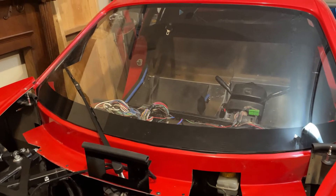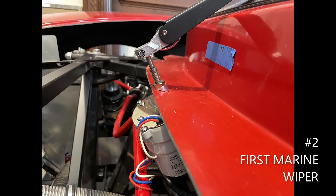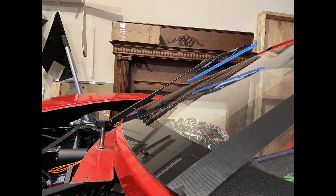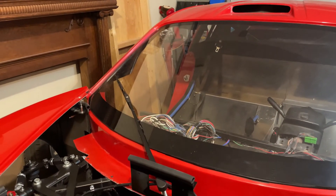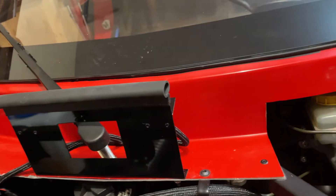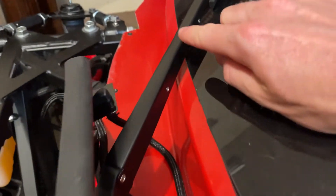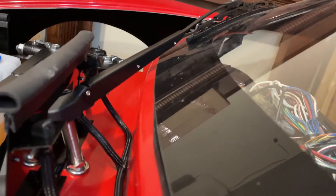After weeks of work and several iterations, this is my final wiper system. I'm using a 20-inch wiper which is a decently long wiper — it does wipe most of the windshield. The black sheet here with the rubber trim on top is a hood standoff, so it holds the hood up a little bit to give room for this arm to go underneath. There's not a lot of clearance between the hood and the windshield on my car — about an inch or so — so we're dealing with some pretty tight tolerances.